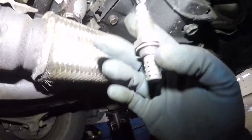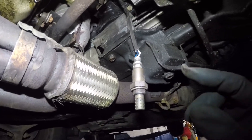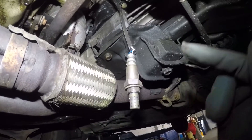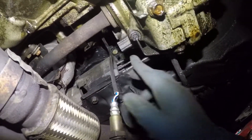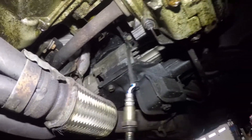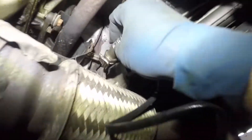Notice the new sensor has anti-seize on it. The new package does come with anti-seize — it's that little gray paste; put that all around the threads before installing. We're going to install the new sensor in here. I'm going to put the zip ties back together, and then once I disconnect the old connector up top I'll pull the old sensor upward and we're done.